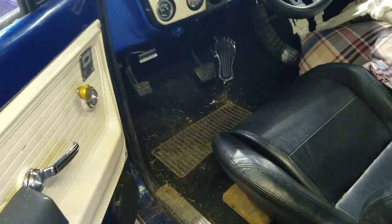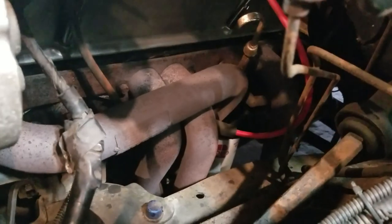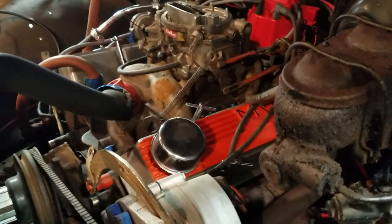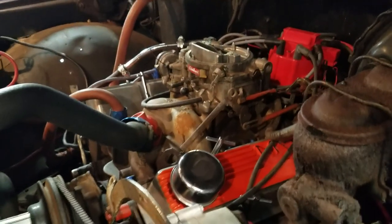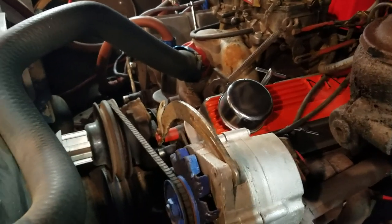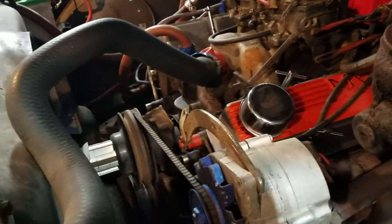There it is — I do have an oil leak. It's pretty bad, down there at the valve cover gasket. It sounds good, but it just doesn't sound like it's supposed to. It's really slow revving, it doesn't have much power. And that would indicate that it is a tooth out of time. It runs a little bit hotter than it should, but that's because it's a tooth out.